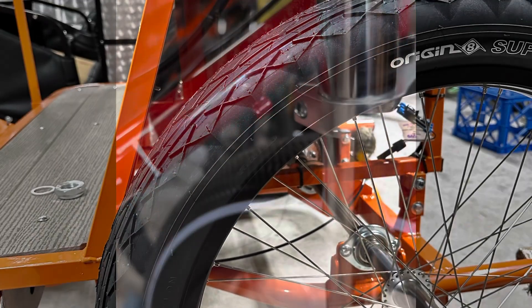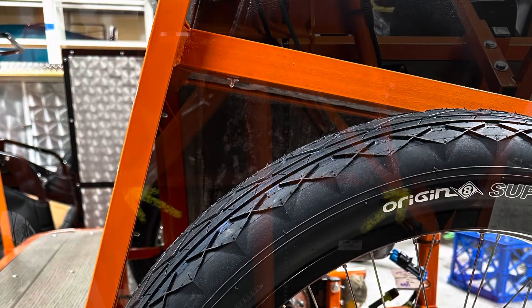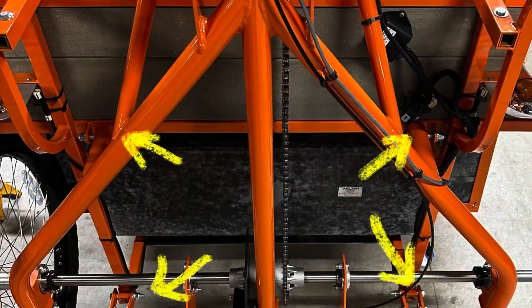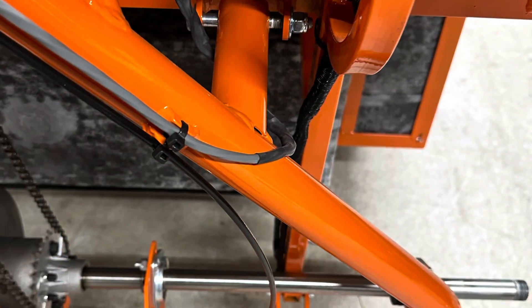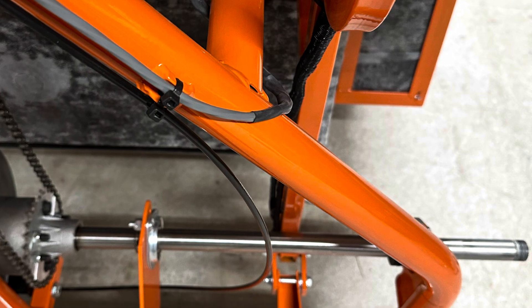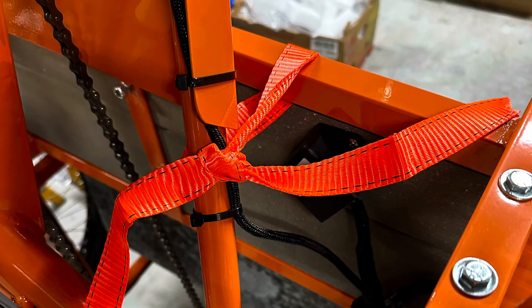Now to gain clearance for the rear tires. These are the four points where the carriage body attaches to the chassis. If you have another person with you, it may actually be easier to completely remove the body. It's possible to do by yourself with the cab standing up, but it's advisable to use some sort of safety strap so the chassis won't accidentally crash down on you.